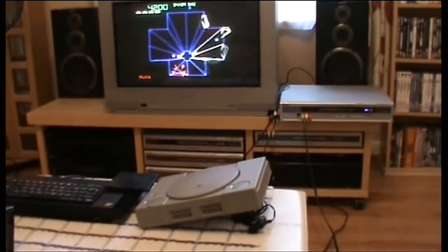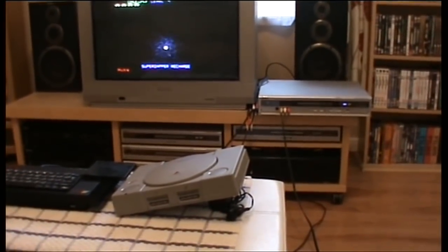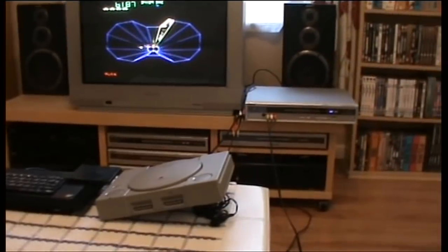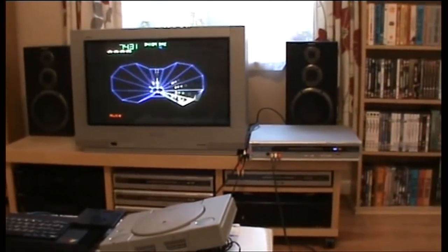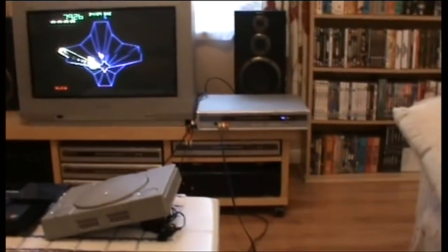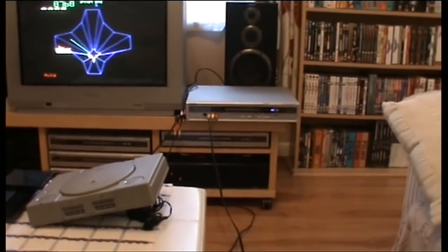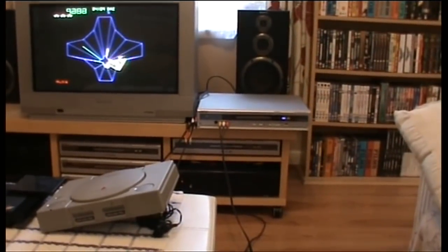That's basically it. I just wanted to show you it is very simple to record old retro games — it's no different than recording a TV channel. Back in the late 80s I used to do it on video cassettes using the RF output, which was obviously very weak. We didn't have SCART back then, but we'd all do it to show our mates at school. There's no reason you can't put a SCART lead into your old machine and record. It all comes down to your DVD recorder — it needs to accept RGB input color.